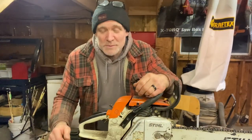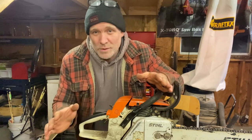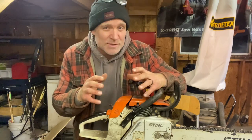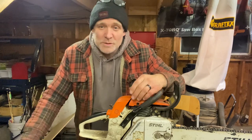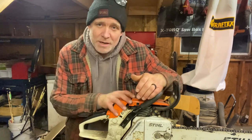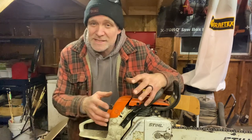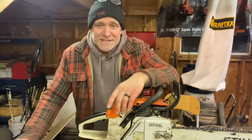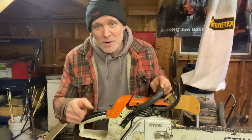There you go — the chainsaw is up and running, it runs real good. I really haven't had any problem with those Chinese carburetors — they've been great. Next Saturday we're going to cut a little firewood. I'm going to try to run it a little bit, make sure it's running real good, and I might have to adjust it one more time, then I'll give it back to him. Whenever the temperature changes — if you go from summer to winter — you need to adjust your carburetor, because drastic temperature changes affect how lean or rich the saw will run. It's really important to know how to adjust your chainsaw, especially when you put a new carburetor on. Nothing worse than burning out your saw if you don't adjust it properly.